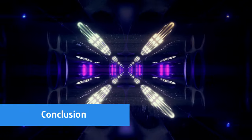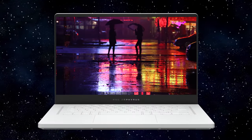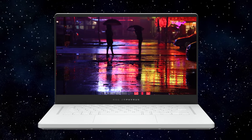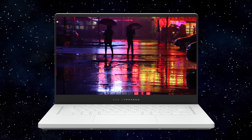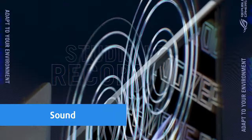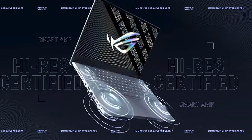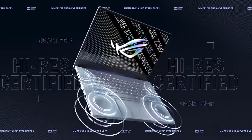ASUS ROG Zephyrus G15's IPS panel has a QHD resolution, 165Hz refresh rate, paired with very quick pixel response times, good contrast ratio, and comfortable viewing angles. Also, it doesn't flicker at any brightness level. It covers 100% of the sRGB color space and spreads almost fully to the DCI-P3 gamut, which results in a very rich image. Also, the color accuracy is pretty good, especially when our gaming and web design profile is applied. ASUS ROG Zephyrus G15's 6 speakers produce a very good quality sound, with no deviations across the entire frequency spectrum.